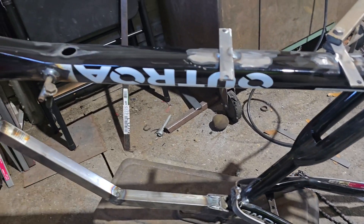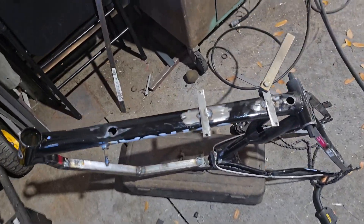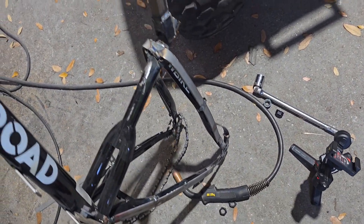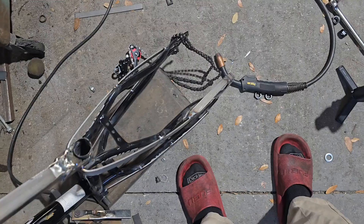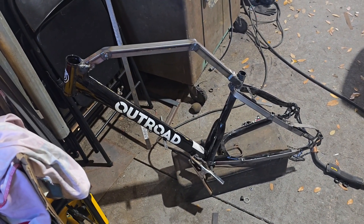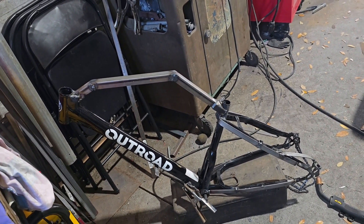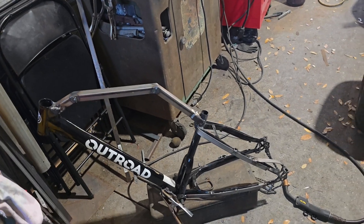Let me show you what's going on with the frame so far — got everything pretty much ready to go. I'm going to smooth everything out when I'm done; all of this is going to be sandblasted. Still got some finishing and smoothing out of welds to do — the weld is cold right now so I have to adjust the heat settings a little bit to get it nice and uniform. But yeah, we're pretty much done welding up this frame. We're going to sandblast the old stickers and everything off — it's going to be a custom frame. That's how I do it, DIY, it's not a machine weld or anything like that.